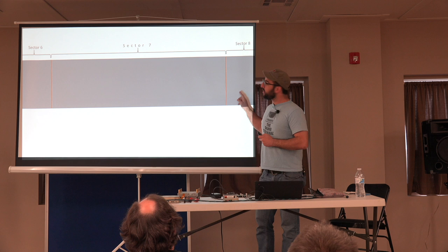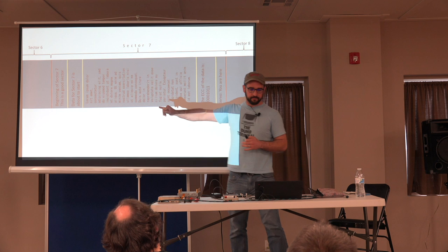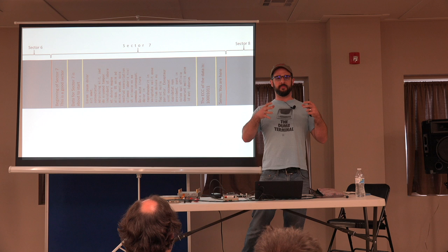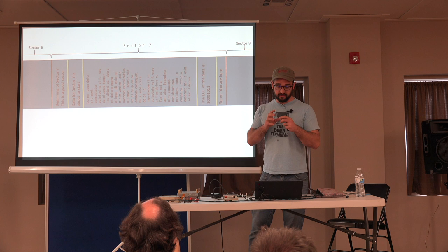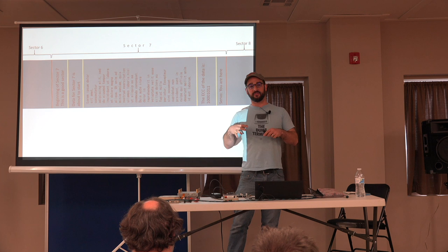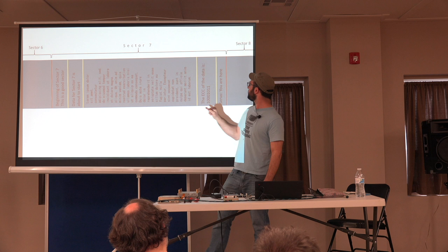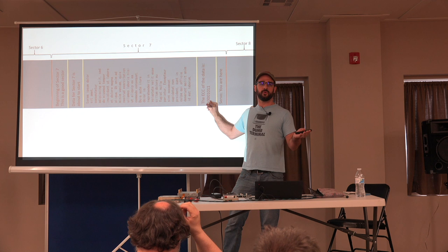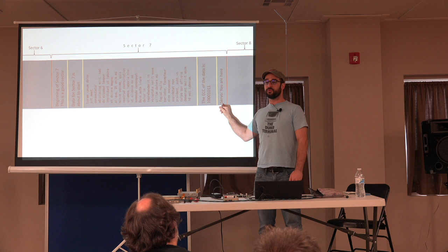There are a number of data fields inside of the sector on a hard disk. Way at the beginning, there's going to be a header that tells the drive, okay, this is the beginning of this sector, it's a good sector, information that tells the controller what sector this is, and then another field that says the data is about to start, and then this field that contains your data. Now, if you're in your operating system and you do your disk format, all you're changing is the stuff inside this field. You're not touching the first two fields. There might be some error correcting code that gets generated by the disk controller. DOS isn't touching that, but the controller handles it. And then you might have some servo information that the controller reads to help it know where the heads are.